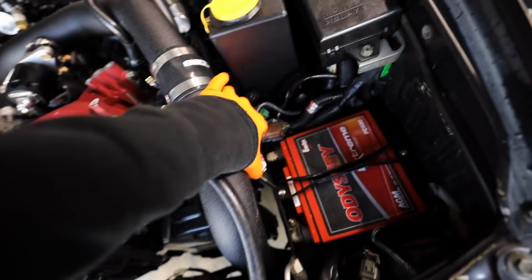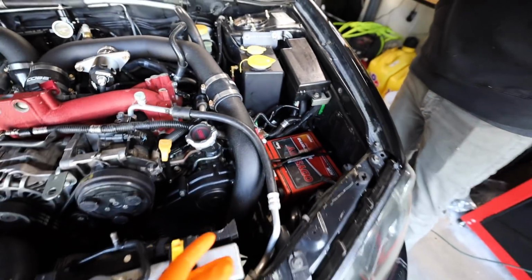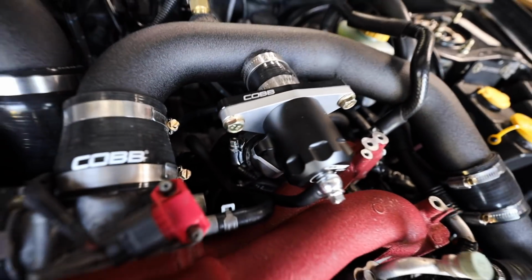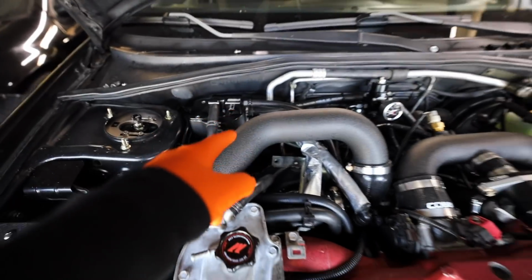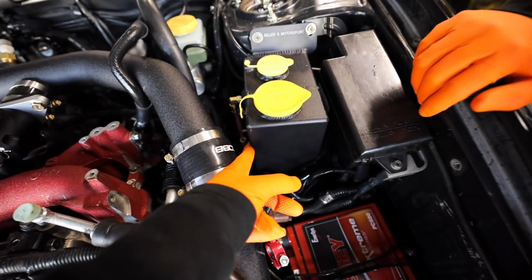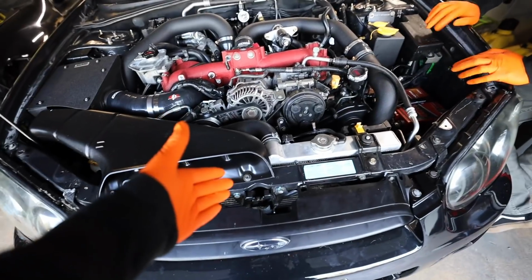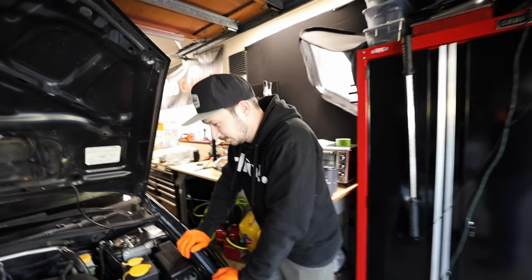So while I'm doing that, Matt's gonna be up here. We have an OEM battery terminal to swap on here because this one is pretty trash and I did electrocute myself yesterday with the battery. That really wakes you up in the morning. The LF bypass valve, the hose down there needs to be cleaned up a little bit. And then a temporary hose needs to be run from the turbo inlet up to the AOS. Then we need to figure out these radiator lines as well. And that one also, we need to go to Lowe's and get a 90 NPT to connect it to that. But it's progress. So I'll hop under the car, I'll start doing some cutting. You hop up here and we'll just do all the stuff.